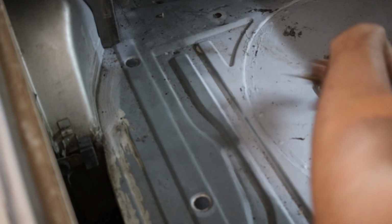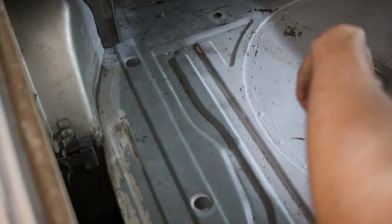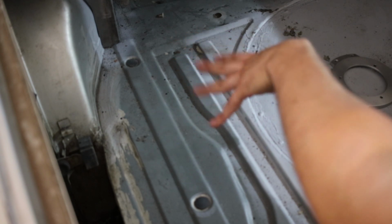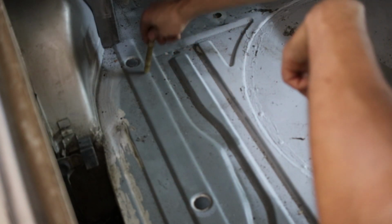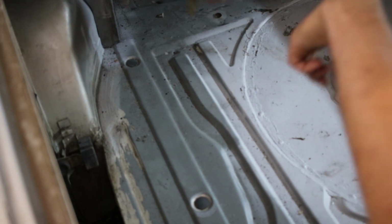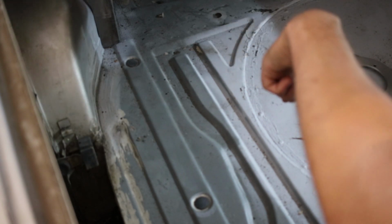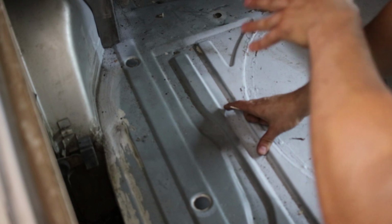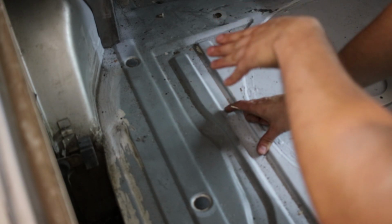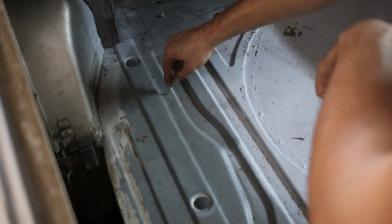So we're gonna put the surge tank over here, like we marked out a second ago, just to try and even out what's in the back. We got the battery over here, we'll have the tank over here, and then that'll also give us the shortest lines as possible, because we're gonna come through the floor back there somewhere, run the AN lines up, and you want shorter lines and you want straight lines, so keeping them as straight and short as possible is ideal.